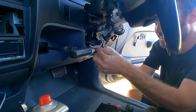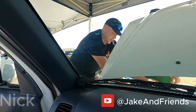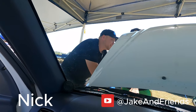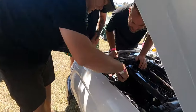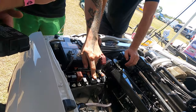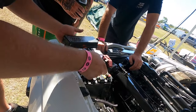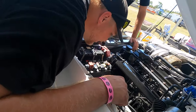Here we are. Yeah, the starter relay in the fuse box up here is missing. Starter gone. No relay. Well, that's interesting. So there will be a relay somewhere. Yeah, but no. The problem isn't we need a relay. The problem is we need to find the starter relay. Yeah, I can't run the full voltage through the ECU. No, I would prefer we didn't.